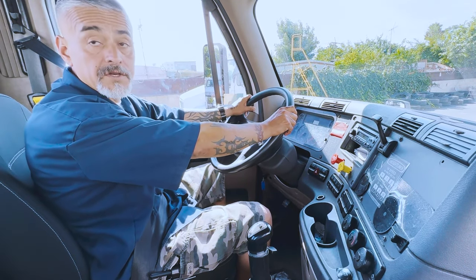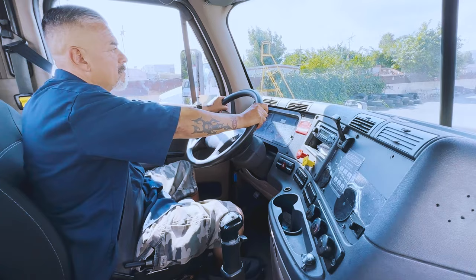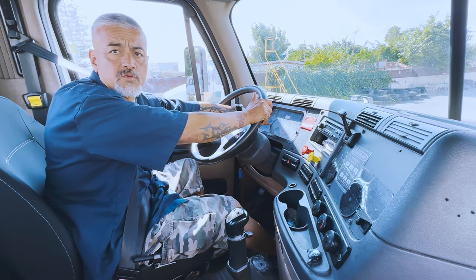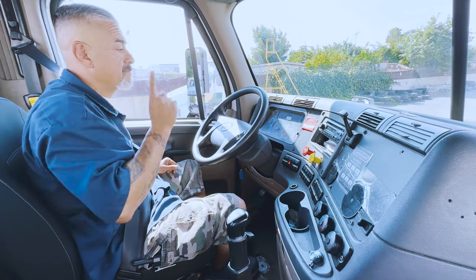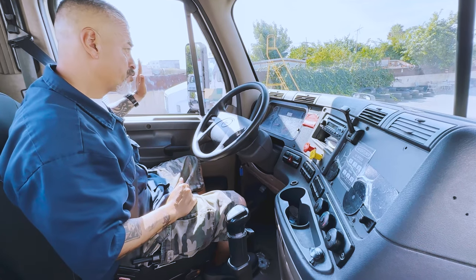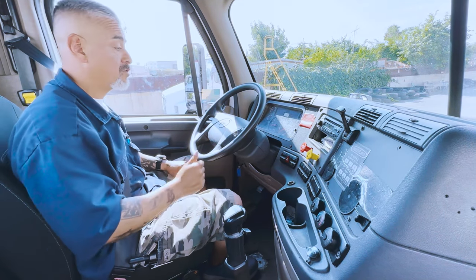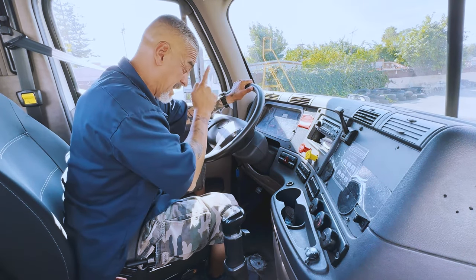Now you're going to tell the examiner you're going to start the truck. If the examiner gives you instructions to accelerate to build the pressure up quicker, you're going to accelerate, but don't go over 10 RPMs, which is 1000. If the examiner does not give you instructions, let the truck build the air by itself. Stay focused on your truck, do not get distracted. You might have a truck on your left or right side — the governor cutout might happen on those trucks, not yours. Stay focused for that sound and keep your eyes on your gauges.